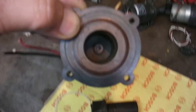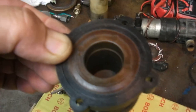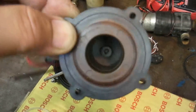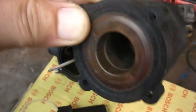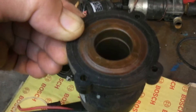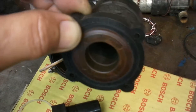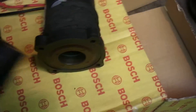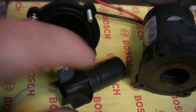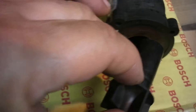Inside, it's just nothing. It runs on an envelope of water and it's supposed to last forever. This is an intercooler pump for Shelby Mustangs or mostly intercooled cars, and it's supposed to pump out more than the large Bosch that I just installed. It failed — it could be because I was having some alternator problems, maybe it was overcharging or there was a spike, but I doubt it. I think something with the alignment just wouldn't turn — you could tell there was energy going to it but it was jamming, the wall of the thing was jamming together.